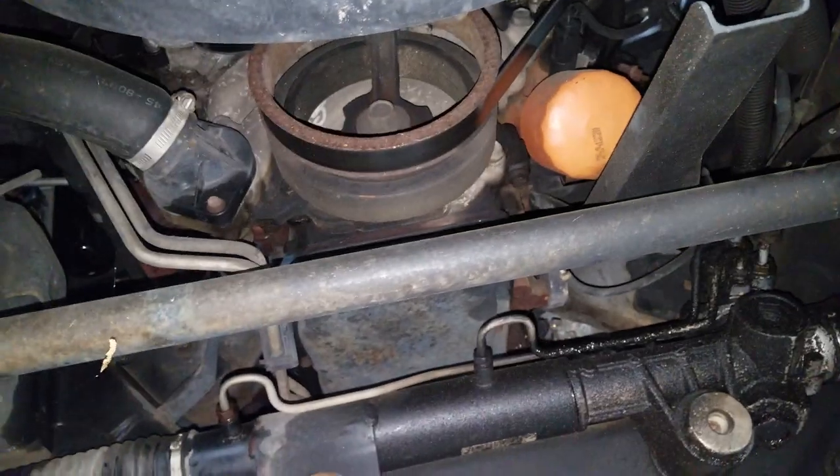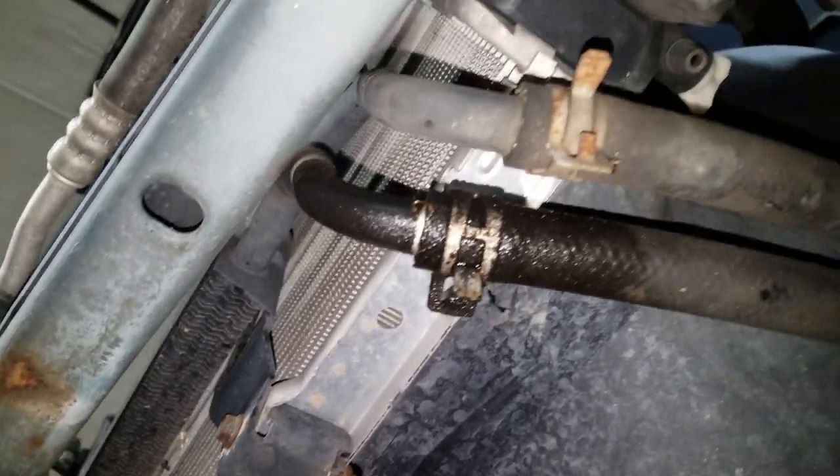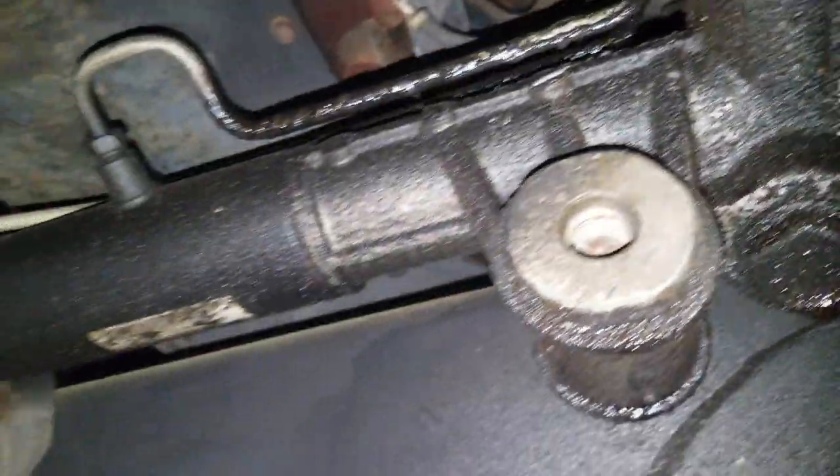Like I say, no need for me to record this. The real purpose of this video is to inform you that any particular area that you're working on, looking at, or inspecting, make sure you give it a good, thorough inspection. Okay? If you're dealing with power steering, make sure you look at everything related to power steering, even the power steering cooler. That's a cooler to help keep the power steering fluid from overheating. As you can see, had I not inspected that, I would have been burnt. It probably would have come back, because this line going to the cooler, which goes to the power steering pump, is leaking. Okay, so again, the purpose of this video is to try to stress the importance of a good visual inspection.